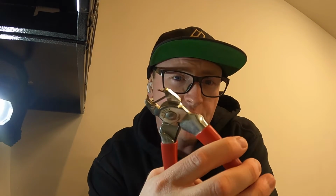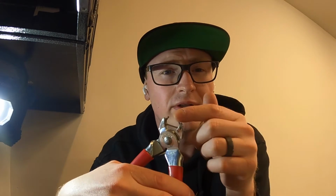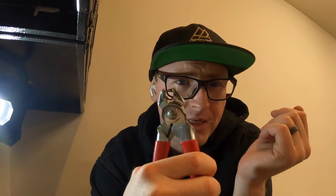When attaching the seat covers to the seats, there is a metal rod in the foam of the seats and the bolsters and everything that these hog rings go to. And all I'm gonna be doing is, while I'm disassembling the old seat covers, just kind of take mental note of where the hog rings are and installing these. Now, I will clip through the seat cover. Sometimes there's a special piece of fabric, or they'll extend it, or it'll just go right through the vinyl itself. And then you clip it in, and it makes this nice little triangle thing, and it creates a little ring.